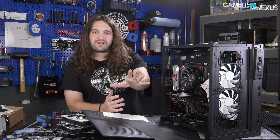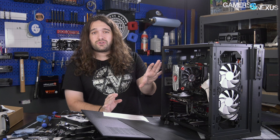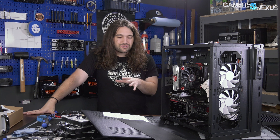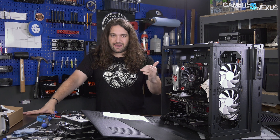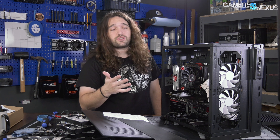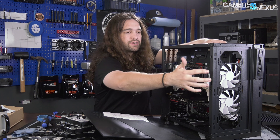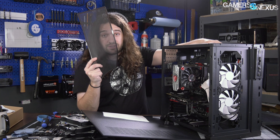The upside is that this is not a fundamental flaw — it is not inherent to the design of the case. You can just remove the filter if it concerns you. When the filter is in, performance might leave you disillusioned for an airflow-targeted case. Removing it, it does great. And if you do want a filter, Silverstone makes really good 120mm sized ones, most of them magnetic. You could buy two of those and slap them right over the two front fans — more air will get through those than through the stock filter.